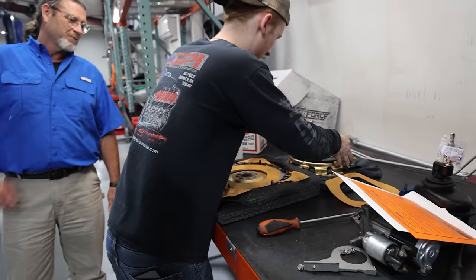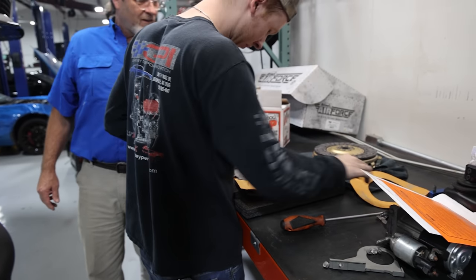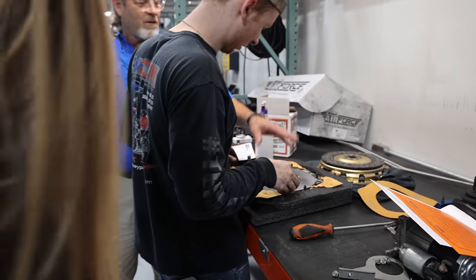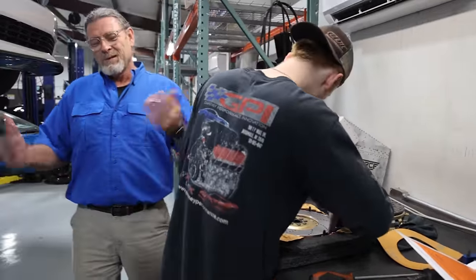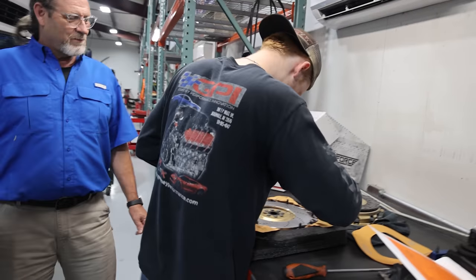So this would be the city. We used to get them broken in. I'd have them sandblast the floater, the pressure plate, and the flywheel, and they'd basically bead blast it. And you don't have to break it in. It didn't require any breaking in that way. It was like an extra charge.